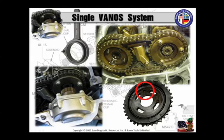Now you're going to remove the Vanos from the engine head. Mount the sprocket turning tool on the exhaust sprocket. You're going to wiggle the Vanos back and forth, but try to keep it in a clockwise direction as you're doing this. Turning that exhaust sprocket clockwise is going to facilitate the chain slop, which will allow the intake sprocket clockwise rotation, which in turn allows the Vanos splined shaft to be retracted. Watch out for that oil, because it's going to go everywhere.